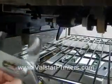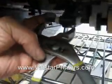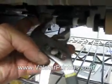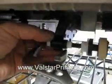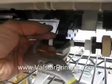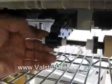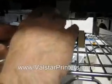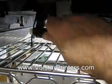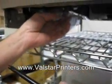Okay, now we're going to need to collapse the pliers a little bit more and do it again to get it the rest of the way through. Oh, sorry, I had it up too high. It'll stick a little here on the end, and there it is, all the way to the end. You can even do this one-handed in most cases, just with the pinky holding against the wheel and your thumb against the center.